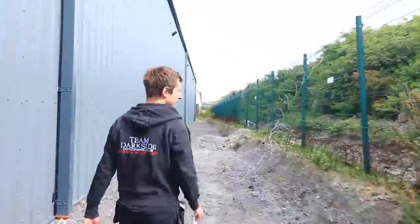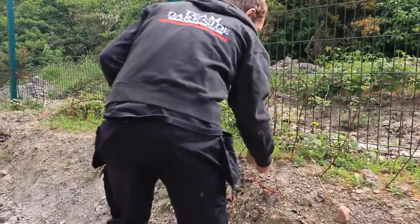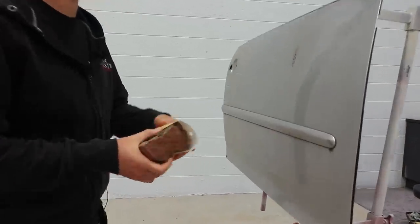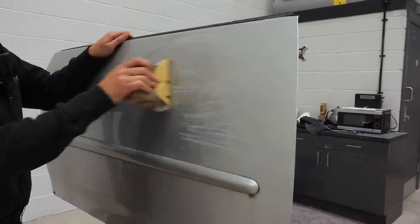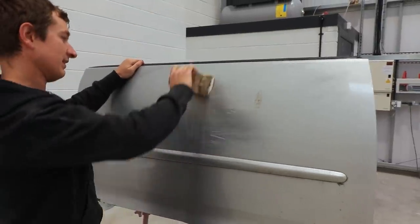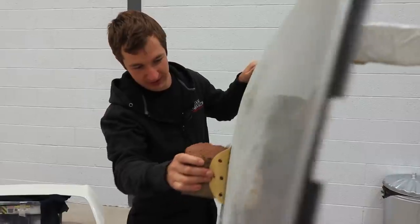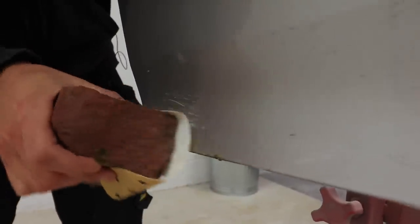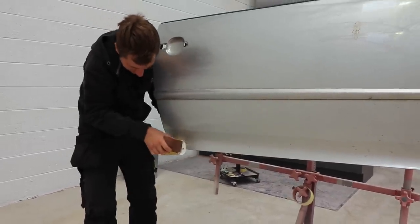That's the baby - fits me sweet, let's do it. Got the brick with nice cushions on it so it's not too uncomfortable. Makes a big difference having a block. Got to make sure we key all the panelling - don't want it not to stick properly. The main areas are these rusty bits - take them off because that'll definitely show through if you don't smooth it a little bit. It's a bit big for me this brick; when I grow up a bit it'll fit me better.